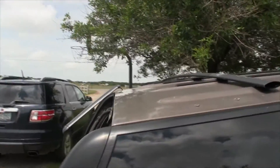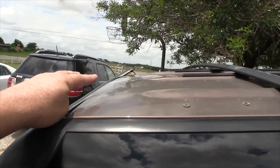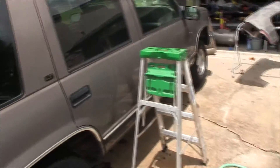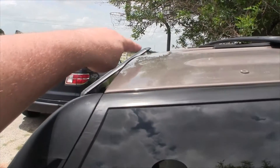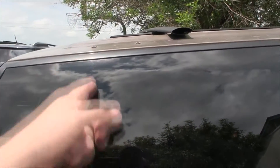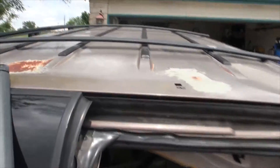I didn't think the brake light would be an issue because the third brake light is far enough back. With the vehicle up on a jack with a good rake — a good angle going backwards — I didn't see how water at this level could go uphill and drip down in this area. But I took the brake light off, taped those two holes, and the leak stopped.